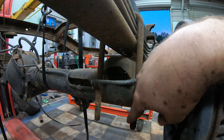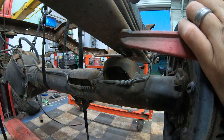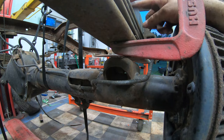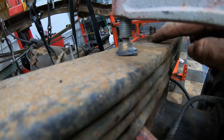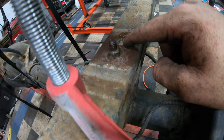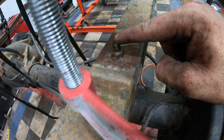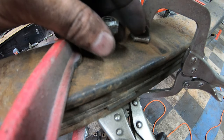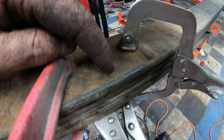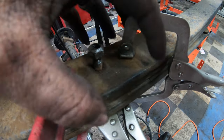Once you've got your nuts loose, you can pull that bottom cap off and take off your U-bolt. Lower your rear end down, and using some clamps, tighten it down on each side of those leaf springs real tight. Take that nut loose on top of the leaf, pull the bolt out through the bottom, and put it back in through the top — because now that your rear end will be on top, you want the dowel pin on top to line up your rear end center. Just take it out, flip it, and put it back in.